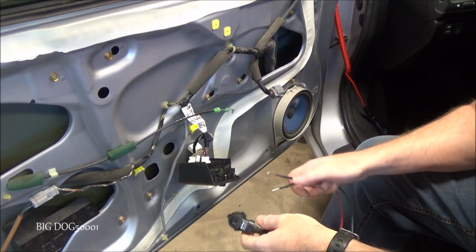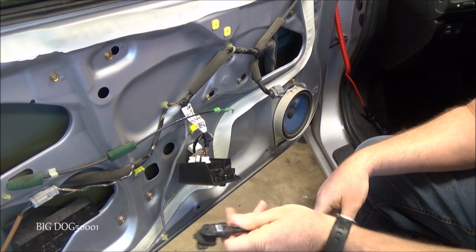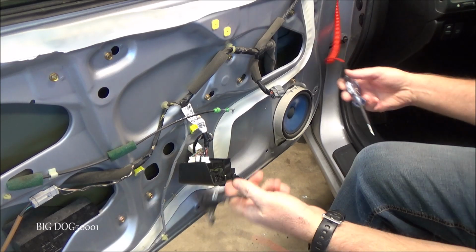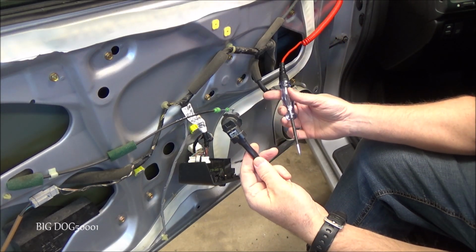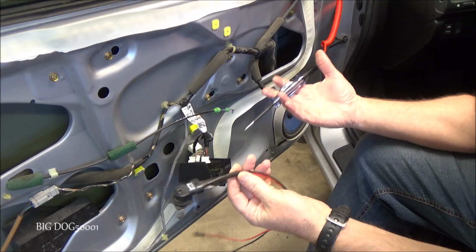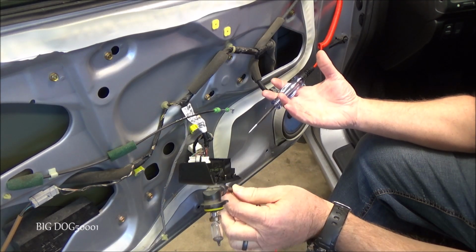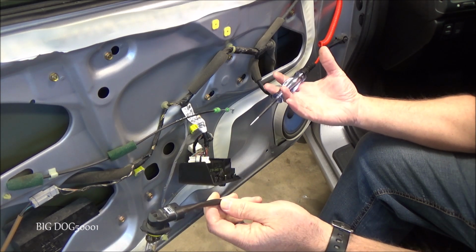Well, there you go. Hope you enjoyed this video on how I go about troubleshooting these Honda Power Window systems with BCAN networks. And most of the time, I can check them out and fix them with simple test lights and a wiring diagram. If I didn't have my fancy scan tool, this is exactly how I would diagnose them anyway. I would just use my test lights and a free wiring diagram from BBB Industries, and I'd go about testing the circuits.